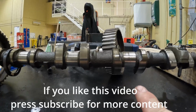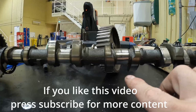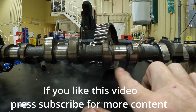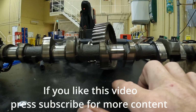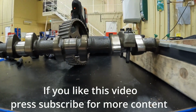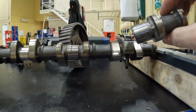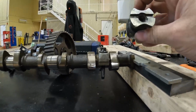So number two and number three were at bottom dead center, meaning that the pistons were at the bottom of the engine, so if anything would have touched or pressed the valve, it would have been cylinder number three, but then the piston was right at the bottom of the engine. So this never even touched a valve, and that's why I'm not worried about those valves being bent, because they never got that far.